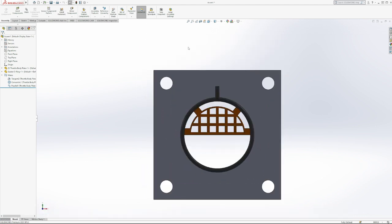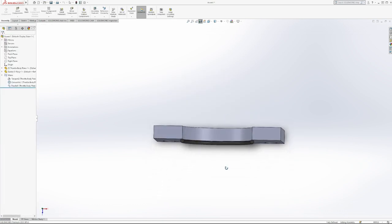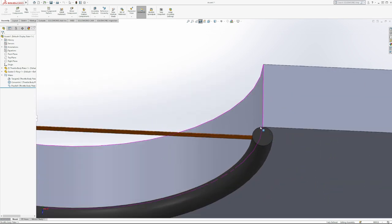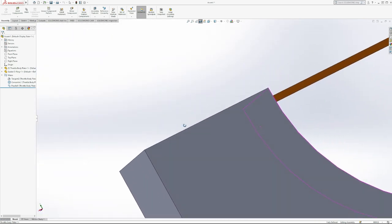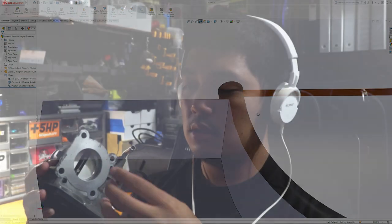So because this gasket is about 52 to 58 and the ID of the 1ZZ sits at 55, that means this gasket will essentially be sitting right on the edge of this metal right here where the throttle body sits, and then there's where it meets this gasket as well. So basically, this gasket will be sitting on this edge. That could be a bad thing because it could potentially lead to some air leakage past the throttle body, because this is not allowing it to properly seat against it, creating a vacuum leak.